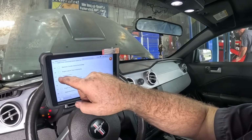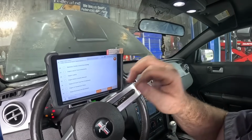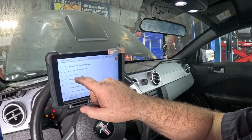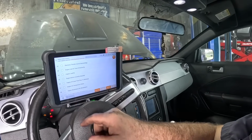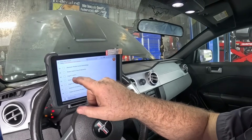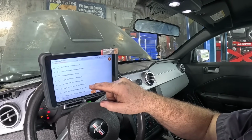If you have an engine load data PID up and you accelerate pretty heavily going down the road, basically wide open throttle momentarily, you should at least see 85 to 90% engine load. If you do, then you know you've got good airflow through the engine, because it's basically using mass airflow data to calculate that engine speed versus mass airflow.